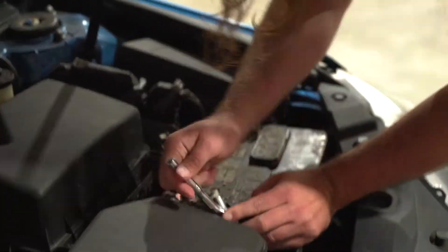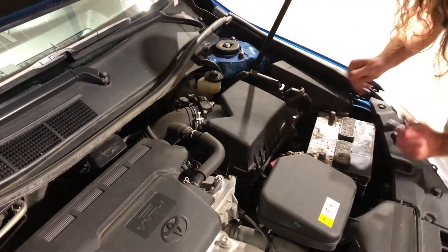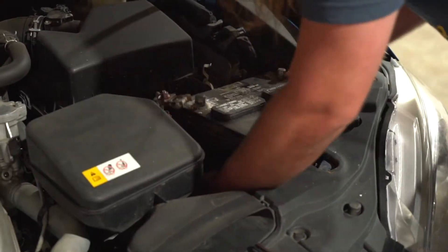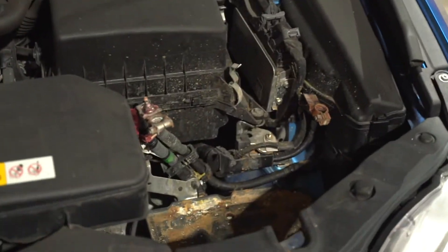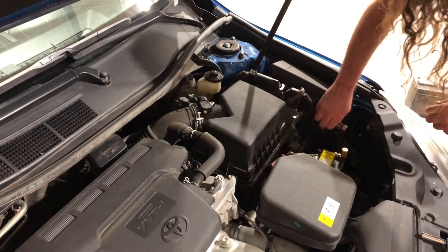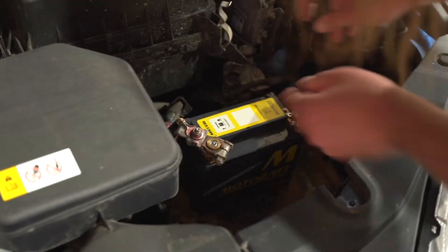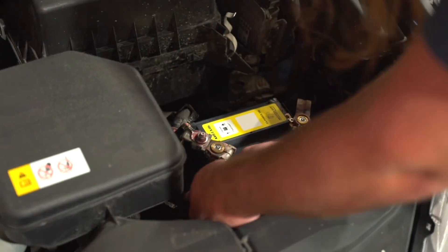So first we disconnect the starting battery from the car, which is a Group 24 Generic Automotive Battery. We're replacing it with the Motobat Lithium AGM Hybrid Motorcycle Battery, the MHTX16. This 2.5 liter inline 4 cylinder requires 585 cold cranking amps in order for it to start, and this Motobat battery only has 350.